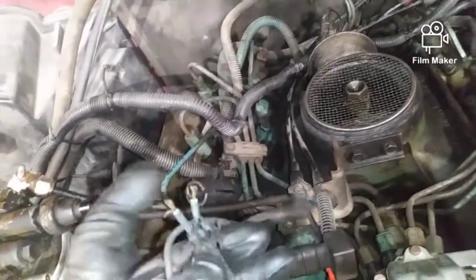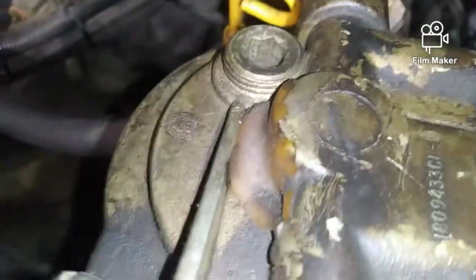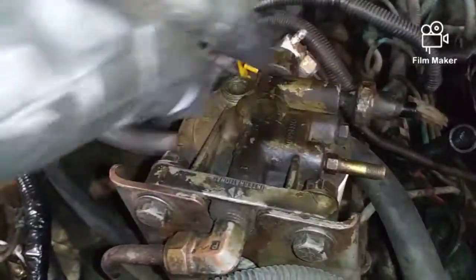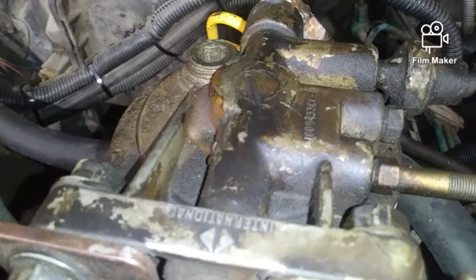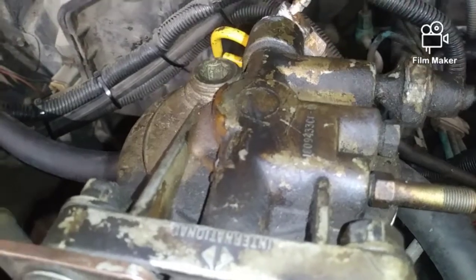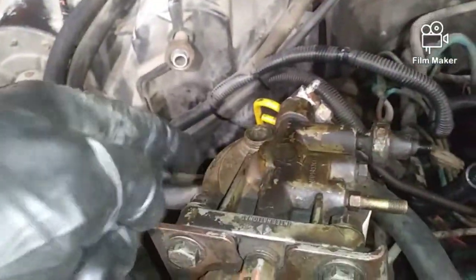So then the blue wire right here, I can't tell if he has a stripe on it or not. Anyways, the blue wire, that one is your heater. Your heater sits in here in the top of the cap like that. A lot of people just plug them because it leaks over time. And this truck is pretty old, so there are plenty of other videos on how to do a delete on that. But the blue wire kind of has a bigger looking cap, goes right there on top. This is a positive wire, and there's just the element in there, and then the element grounds out. It's just a one wire, the same exact one as the water and fuel sensor. Okay, does that make sense?